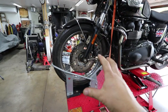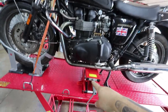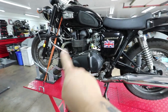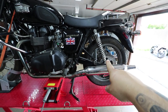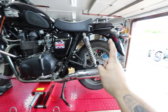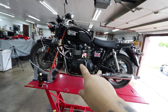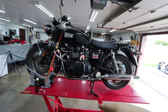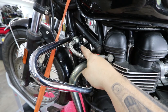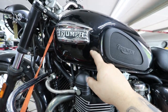The front tire on this is a bit skinny so the wheel chock doesn't hold it as well as I'd like — it was a little shaky. I decided to ratchet down the front end and use my scissor jack underneath, then move the center stand down. Lowering the jack gives me a couple of points of contact. The rear wheel is going to be off for a while while Cognito Moto and my powder coater do their thing. My initial idea was to replace the oil cooler, do an oil change, fill it with fuel, and see if it fires up. The only issue is I have to remove the exhaust and crash bar to get the oil cooler out, and the fuel tank looks like crud inside.